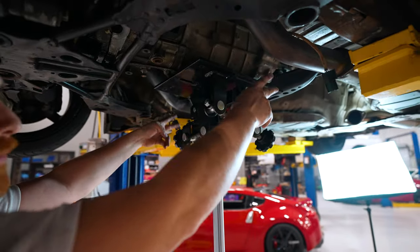Good to go. All right, so drive shaft in, shifter's all good, exhaust all bolted up. Everything should be good. So while I was up there, I could feel pedal head pressure, but there may be a little bit of pedal adjustment we need to do on the backside. So let's get it down, get it off the lift, and see where our engagement is. Goes into gear, everything perfectly fine. Yeah, it needs to be adjusted a little bit. So. But it made no noise.